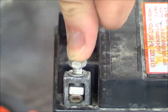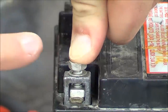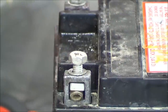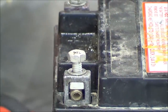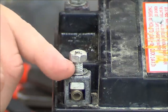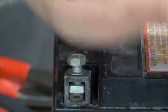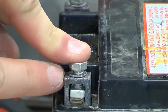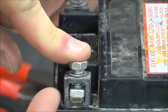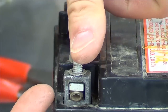Get a close-up of that. If you can't tighten this, that battery cable is going to be loose. We want to make sure that when we do this trick, we aren't creating a new problem. If this has two or three eyelets on it, am I going to have a little compression? If I have two or three eyelets and I look at how tight I'm able to get this, I'll have enough because when I tighten it, it's going to suck the nut up. But this test is how you verify whether the trick is possible.